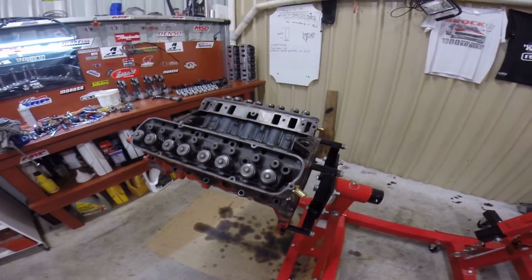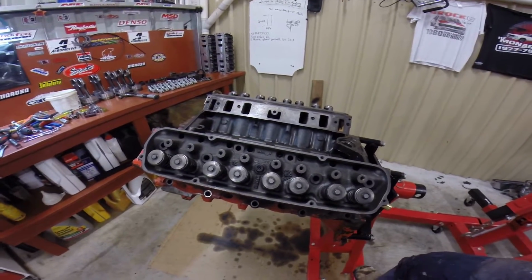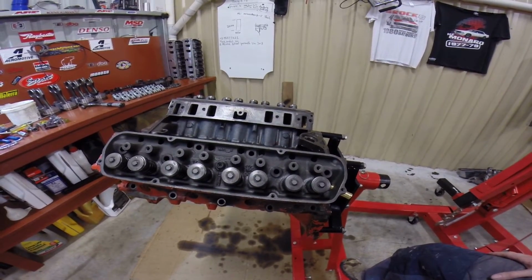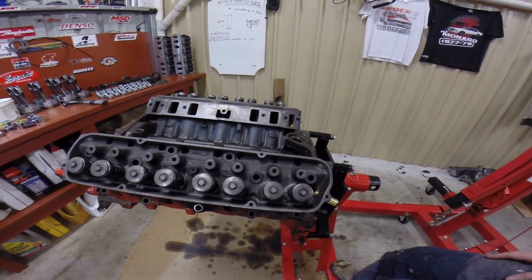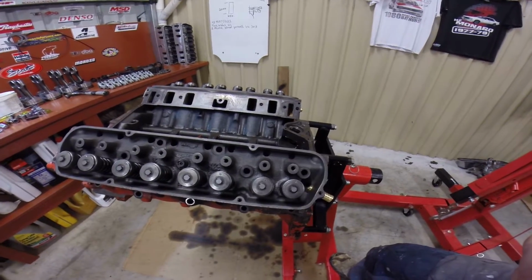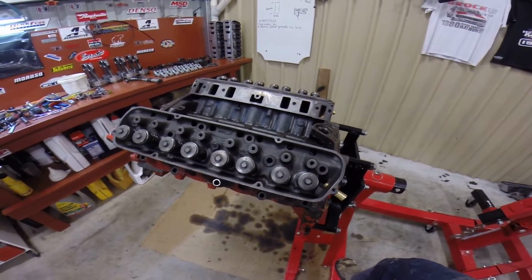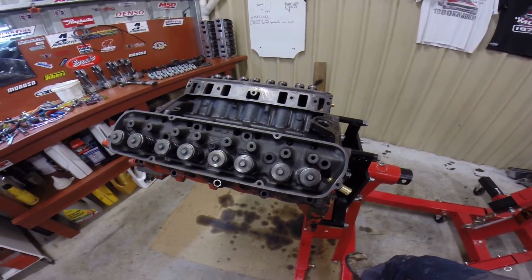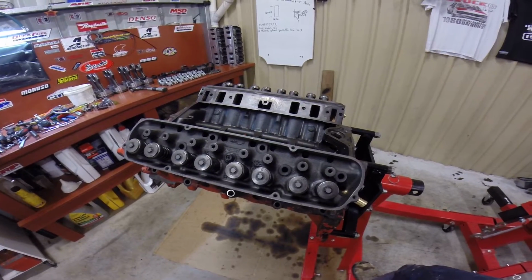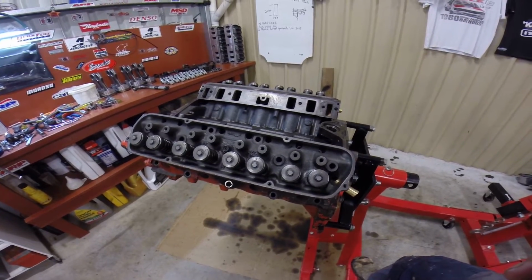But for now, what I've gone and done, and I'll do a recap now on the oiling issues that present with these early Holden motors. A lot of my trouble is the oil floods into the heads, right? Which is not a bad thing, but the trouble is you can't get the oil returning back into the sump quick enough, and I think that's a lot of the trouble I was running into, heading down around the sweeper at around 6,000-ish revs.